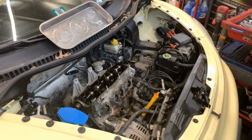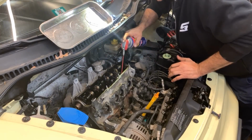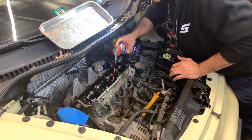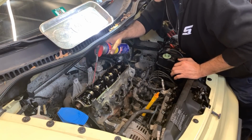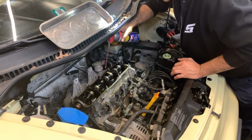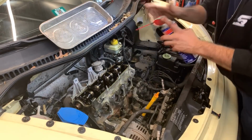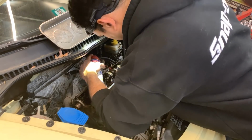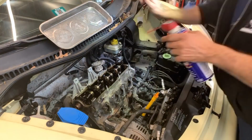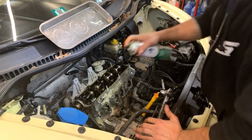It's an Allen wrench. I mean, no matter what, this oil is going to be replaced. You need to, it's a torx. You need to make sure that there is no oil on any of those bolts where you put the key, because otherwise it will get stripped, and that'll be a very, very bad thing. So I use a lot of WD-40. Now a little bit of brake clean.